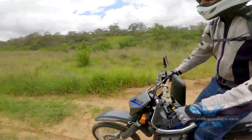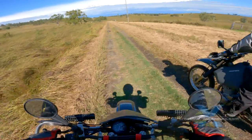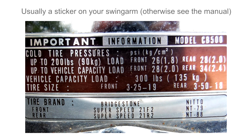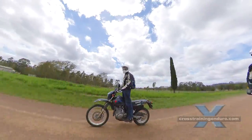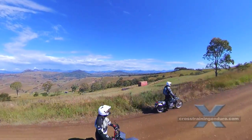These are just very broad guidelines. A second option is to run with the manufacturer's recommendation. At the very least, they will give an air pressure for road riding, which is usually quite accurate. Remember to check the maximum pressures shown on the side of your tires — usually there will be no conflict. Sometimes the motorbike manufacturer gives you a figure for off-road riding. If they don't, you need to work out the best off-road pressure yourself.